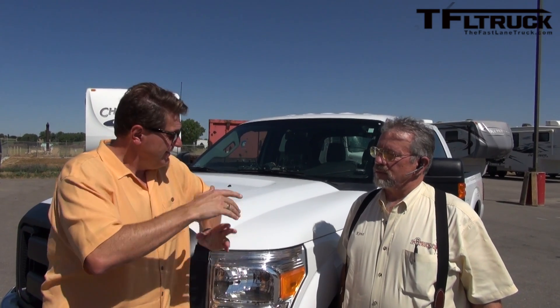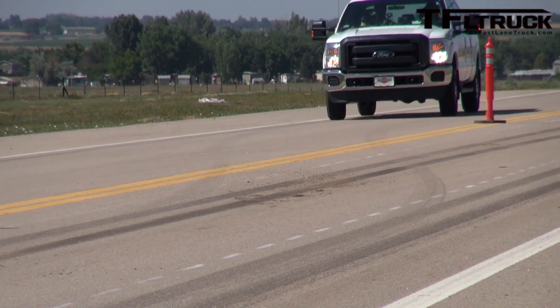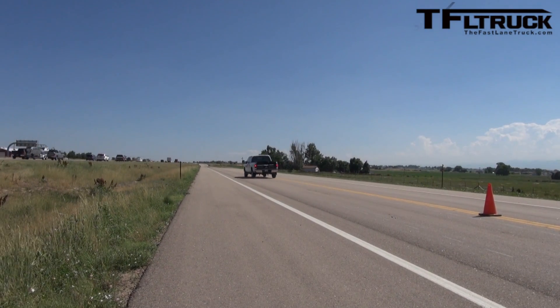Alright Kent, so now we know how high the light beams are, how much squat the F-250 has, how fast it goes from 0 to 60, how fast it stops from 60 to 0, and how much it sways at 50 miles an hour with the standard leaf springs. The next episode is when we go and exchange the leaf spring for the Autoflex air suspension — a complete replacement with nothing factory left except the frame. We'll run these exact same tests again. This is Roman and my newfound trucking friend MrTruck.com Kent — thanks for watching, and come back for episode 2.